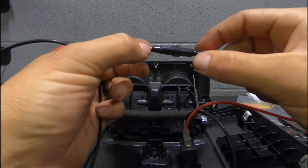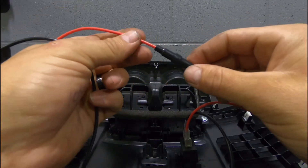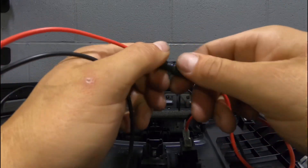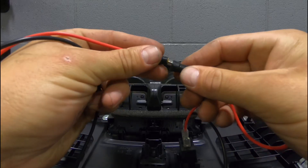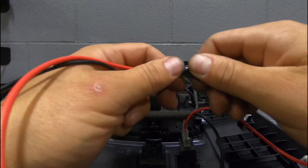What I'm going to do is cut after this fuse — there's a little fuse in here that's protecting the circuit. So if you guys do happen to get this particular USB, there's a fuse in here, and if it doesn't work for whatever reason in the future, the first thing to do is check that fuse.